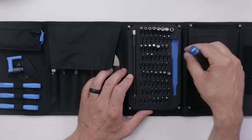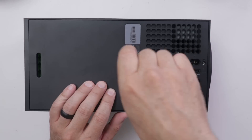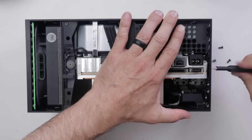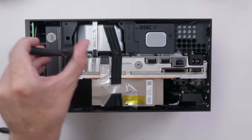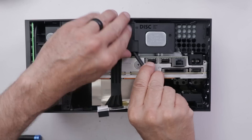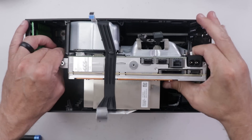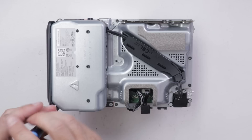I'm going to be needing a security T8. This Xbox Series X I've actually had apart before — this is one of the ones I fixed in my video where I bought a lot of five of them. Now you might be asking yourself, what's so great about liquid metal versus thermal paste? It comes down to thermal conductivity: most thermal paste has a rating of around 12.5 watts per meter Kelvin, whereas liquid metal has a rating of 73 watts per meter Kelvin, showing how much more thermally conductive and efficient liquid metal is.